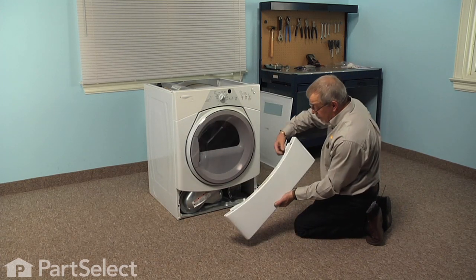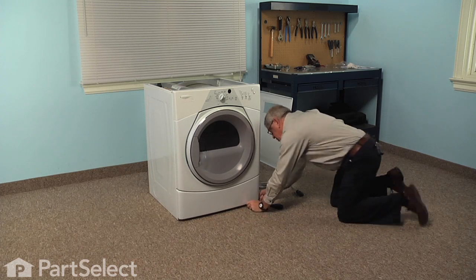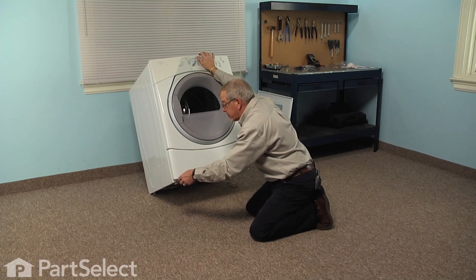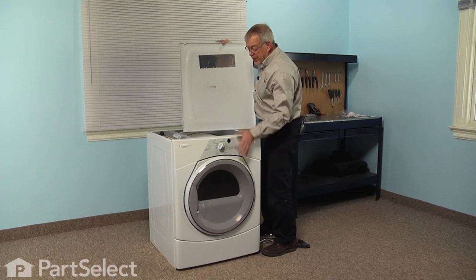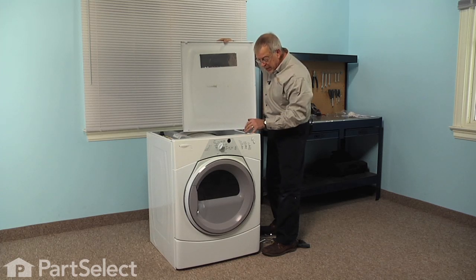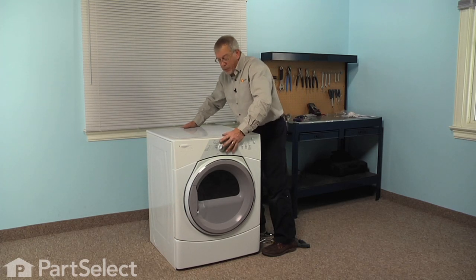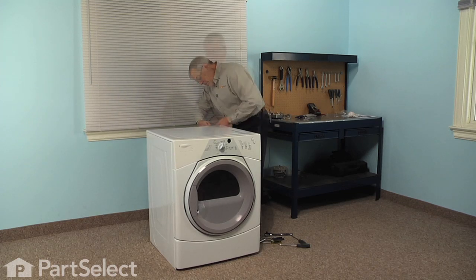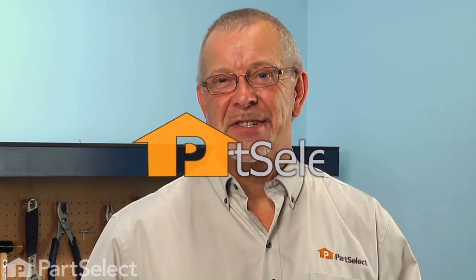We'll reinstall the bottom panel — make sure that the top lip on the panel tucks up underneath the front panel, and hold that in position while you install the quarter-inch screws. If need be, you may have to tilt the dryer back enough to get good access to those two screws on the bottom of the front panel. Tighten them securely, and now we can put the main top back on. When reinstalling the main top on these round door models, there are a couple of tabs that will fit into the slot just where the cabinet is recessed back a little bit behind the crossmember. Lay it into position, make sure it's down nice and flush, push it forward, ensure that it engages those tabs, and install the two quarter-inch screws that hold it in position. We're now ready to reconnect the vent, and our repair is complete. I told you it was an easy job — thanks for watching, and good luck with your repair.